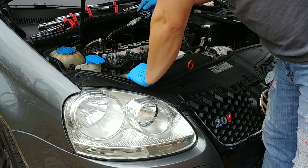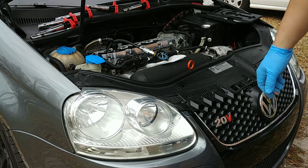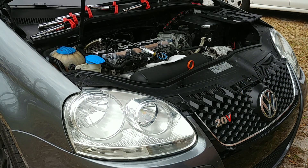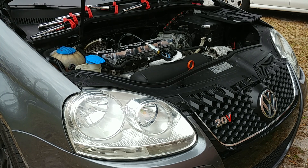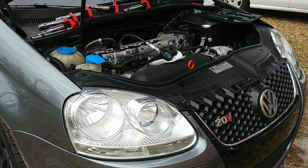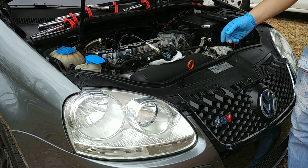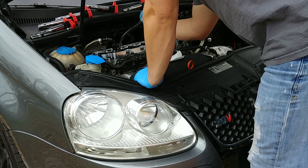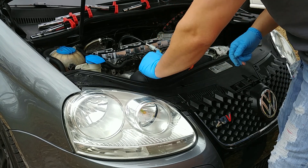About 173 on cylinder number one — not bad at all. We're going to go to cylinder number two. This one's a bit lower, about 142. Not good — the engine's getting tired.